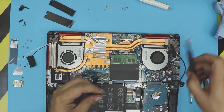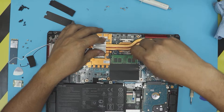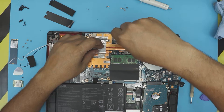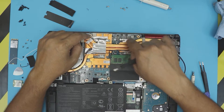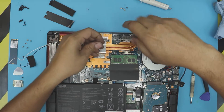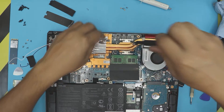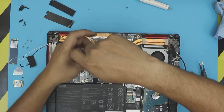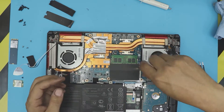Now we're going to cross-screw them first — hold it this way and put the CPU heat sink screws in, always cross-screwing them. You see I did this one first, that one second — there's a number one, two, three, four, or you can do whatever as long as you go across. Cross-screw them, follow the numbers or just cross-screw them. We've got the CPU in place — do the far corner. Then put the two screws on the right fan and three screws on the left.